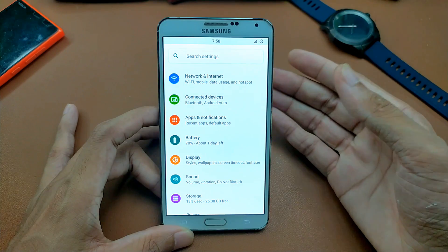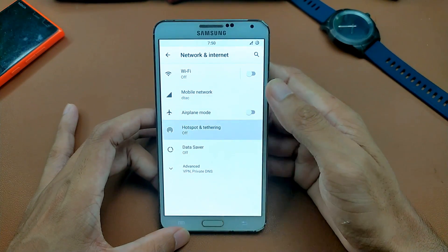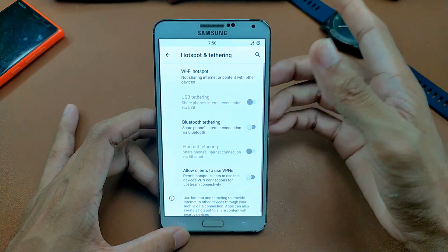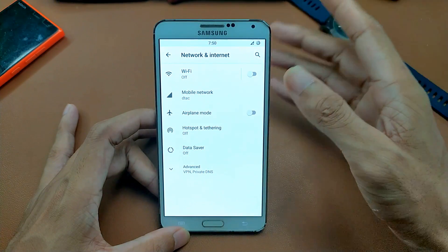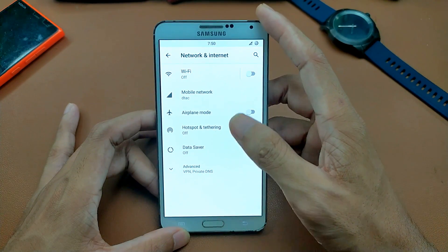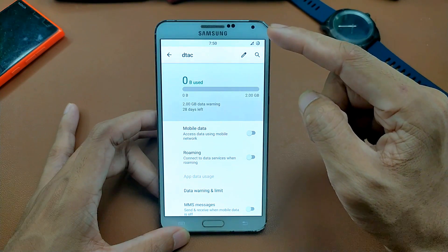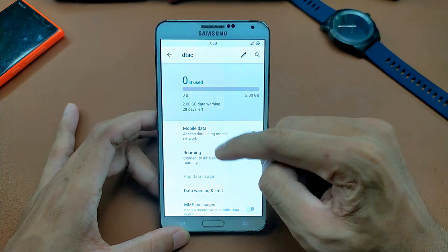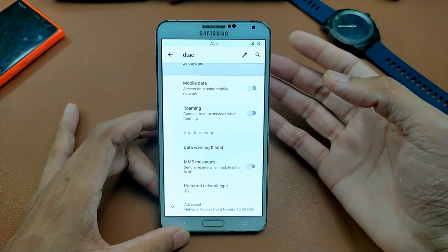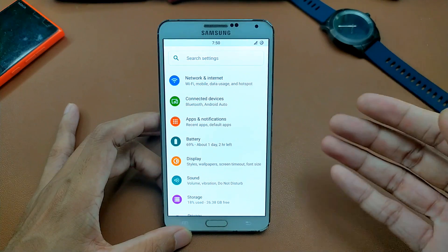In the settings, there are a few things to check. There is a Wi-Fi hotspot option where you can share the 5GHz band directly. However, this device — the Exynos variant — doesn't support 4G, so most probably when you install this ROM it will not get a network signal. You have to go into settings and choose preferred network as 3G, since it defaults to 4G.